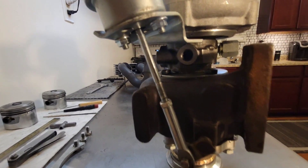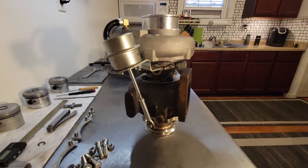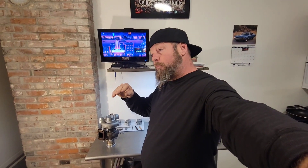This one is adjustable — we can adjust more spring tension to control our base boost. It will control our starting boost so the boost starts at a lower RPM, essentially right off idle that turbo is spinning because the gate is closed. I'm allowing it to open at about 20 psi but it really barely opens — just to vent off a little bit of the extra. I'm also using the charge pressure and venting off with the blow-off valve. It works way better — I'm venting off the pressure, not the exhaust. The exhaust is hitting the turbine, that turbo is spinning, and that's good. The boost pressure I can regulate and control how much goes into the engine.